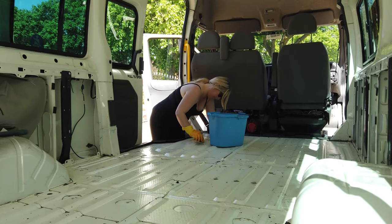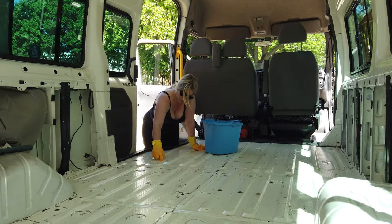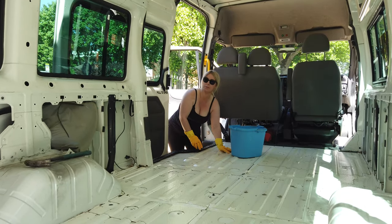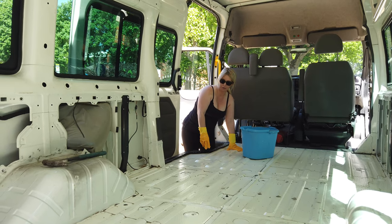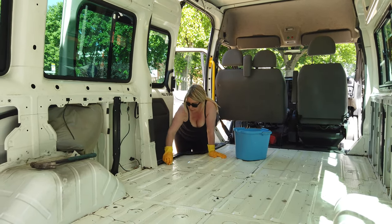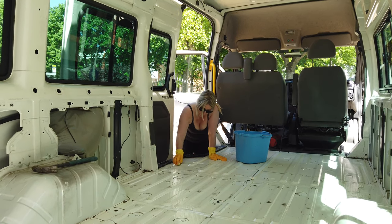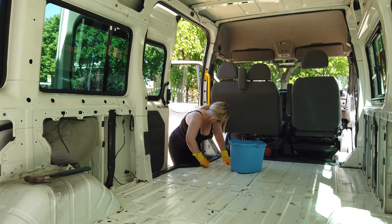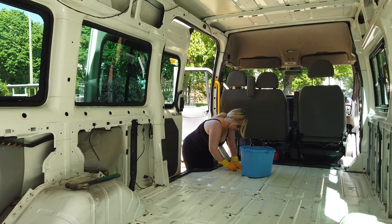I want to get these holes that are the bolts and the seats spotless, so you can see what's going on. Yeah, well, once they're done, they can be dried, just with the air gun, dry them off, and then hammerite them. Yeah. And then they're ready for filler when it arrives tomorrow, because that's glass fibre filler, that one.